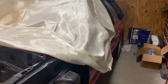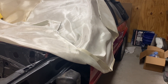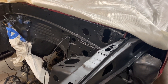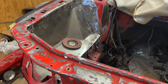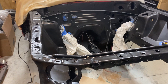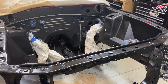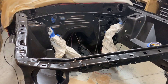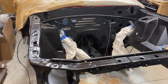I bought this car in 2009. It's got about 84,000 miles on it right now. I'm getting ready to swap it back to an automatic, so I'm in the middle of doing the pedal swap. I've put in the Scott Rod panels — I wanted to shave the engine bay. I'm going to be tucking the wires, maybe not a hundred percent tuck but most of the wires will be hidden, and I'm relocating the battery to the back with an NHRA-approved cutout switch so I can run it at the track.